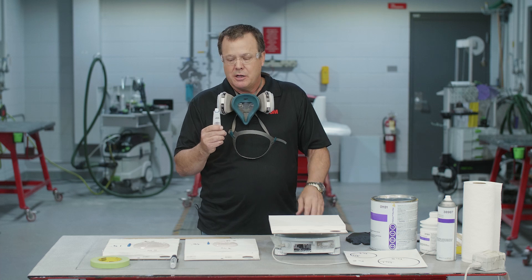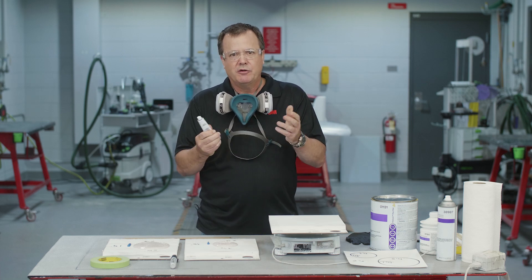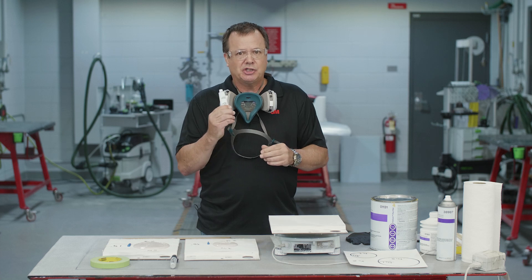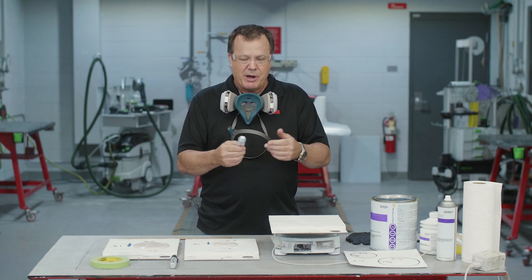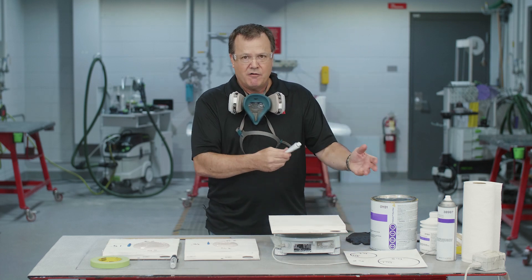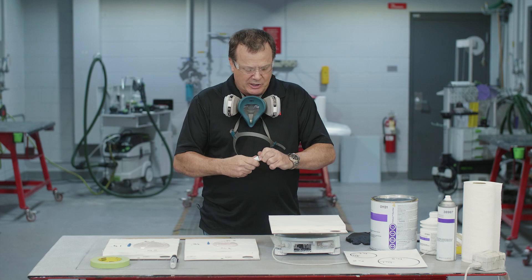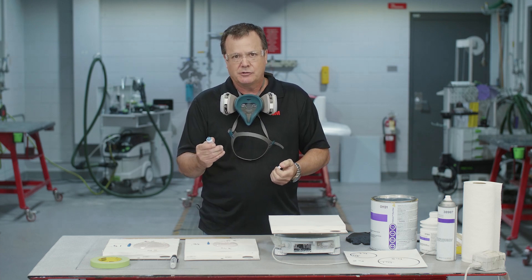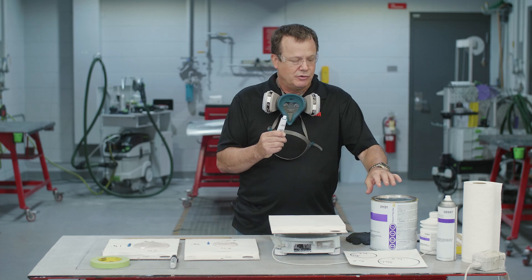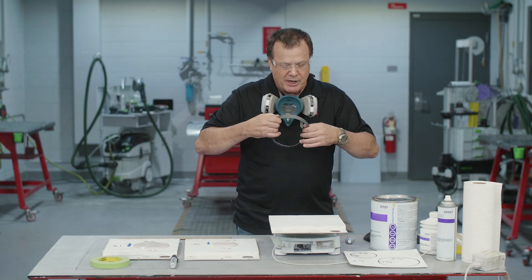Hardener is critical to body filler. A lot of people are worried about the type of filler and don't pay attention to the hardener. Number one — make sure you knead it really well. I'm sure you've all had it where you dispense a little and it all comes out like water. We don't want that. Also use fresh hardener. Try to keep the hardener that came with your can together with that can so you know it's the same freshness as your body filler. I also like to dispense a little onto a paper towel first to avoid that watery material. Finally, make sure you're using the same brand — use a 3M hardener with a 3M body filler. There is a difference.